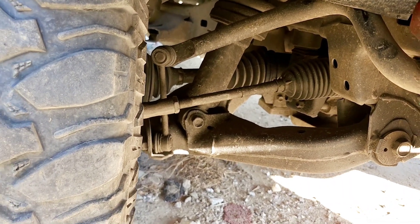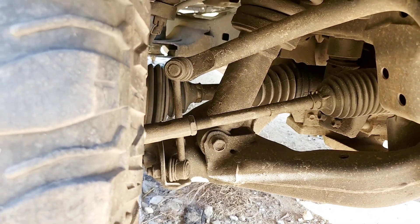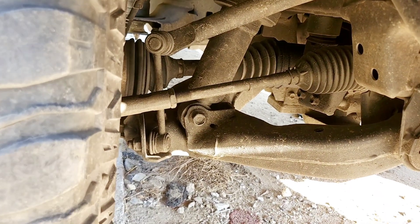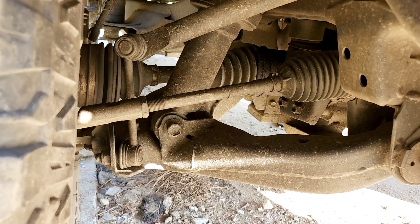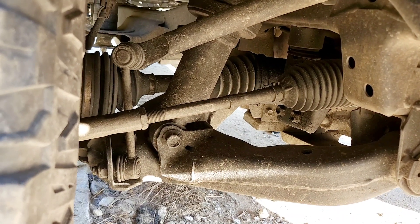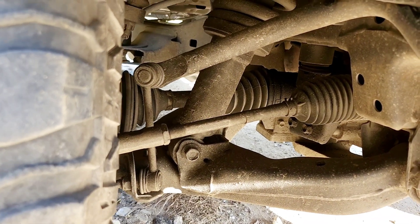Through my experience, if you are going for a two-inch lift, you'd better also go for a differential drop on a D-Max. Don't just go for the lift — as soon as possible, go for the differential drop first, and that will protect your vehicle from breaking CV axles.